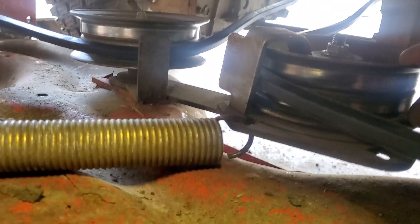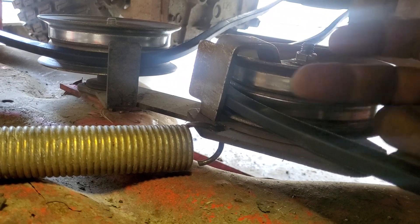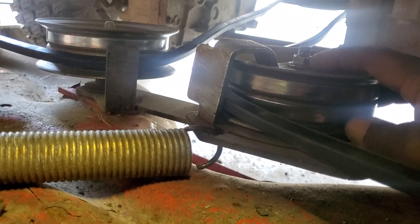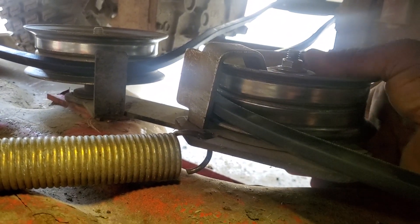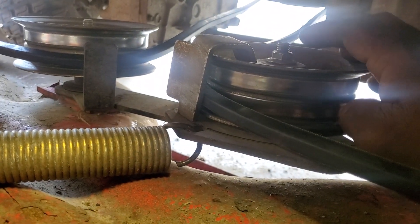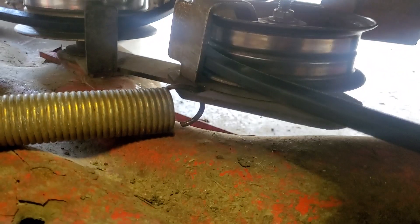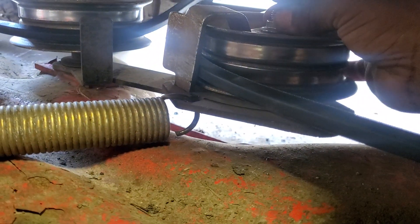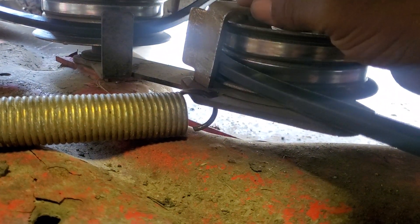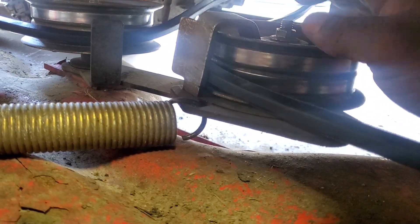This pulley here has a guard to keep the belt on — it supports the belt. There's a nut and a screw on it that goes through, and the nut fits on top. It's a 15 millimeter, so you can use two wrenches or a socket and a wrench underneath. It just unscrews enough to raise this up. You don't have to take it all the way off — just loosen it enough to remove the belt and then install the new belt. You basically keep it raised, put the belt on, then bring it down and tighten it back.